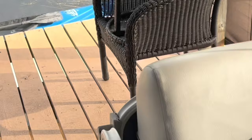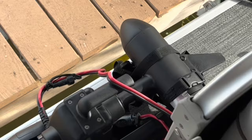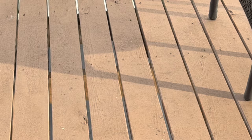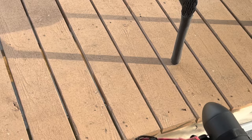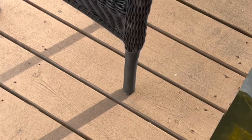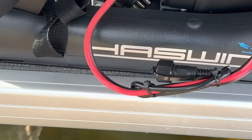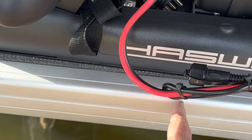You'll want it positioned so that with the gate closed, from the rear of the boat you can see the head of the motor to determine which way it's moving and pointing. All of this drives the consideration of where you're going to mount it. I'd also prefer the motor be on the hinge side of the gate as you walk out, instead of having obstructions on the other side. So it's close to where I've proposed putting it, which means the Tune Troll SR mount with the XB bracket will go somewhere around here.